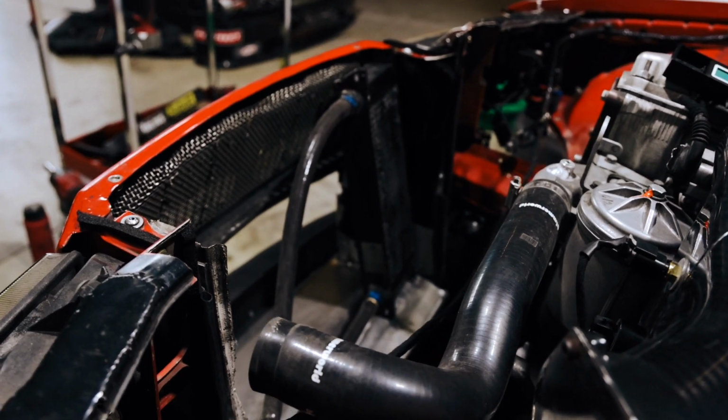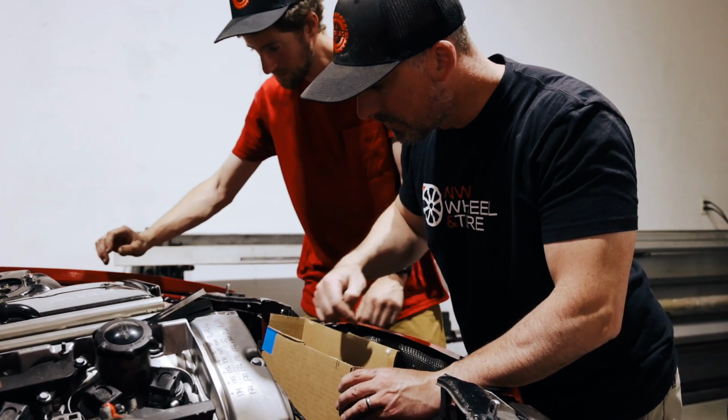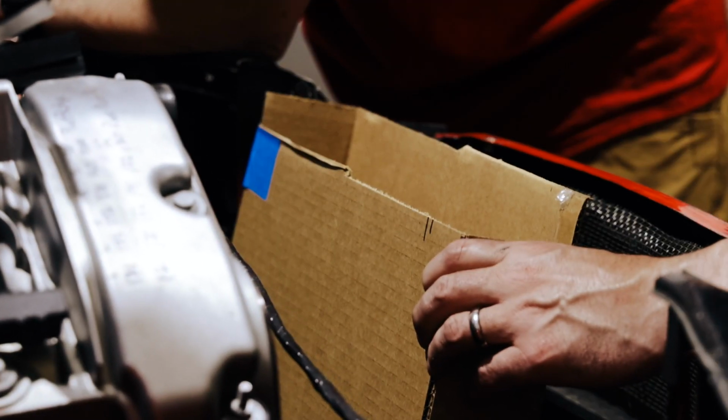We also have a new radiator coming. We had a custom radiator built for the car. It's 20% larger ambient area on the core, a little bit larger end tanks, and no oil cooler or anything like that in there. And we're moving our oil cooler to a different location, so it's not in series with the radiator. And by that I mean the air that comes through the oil cooler doesn't then go through the radiator. This is an advantage because it frees up that area of the core, which was significant. So we're adding ambient size to it in addition to unblocking a decent part of the core by moving the oil cooler. So we'll get better airflow through the oil cooler and the radiator and expose more ambient area.